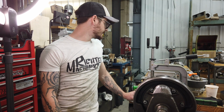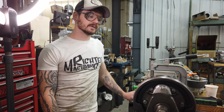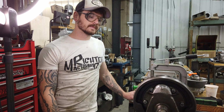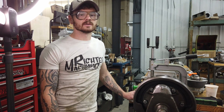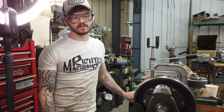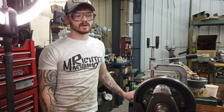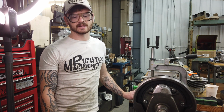But yeah, it's sad. You see this a lot. Some things are okay to reuse, but some things aren't. You just got to know what you're looking for. So crucial components like oil pumps, you can't play around with. You got to take them seriously. So if you have any doubt in your mind, replace it.